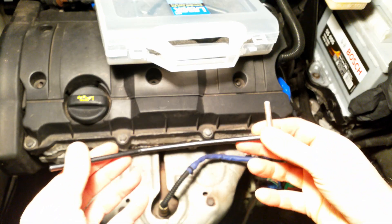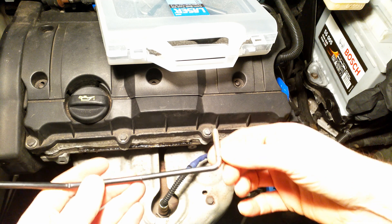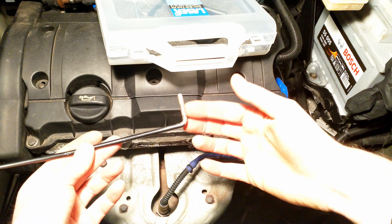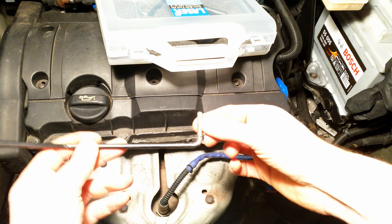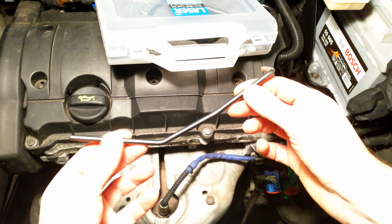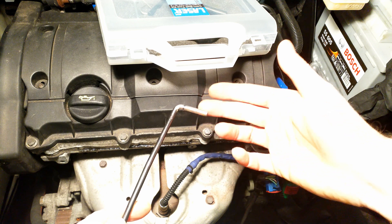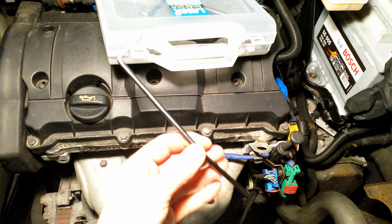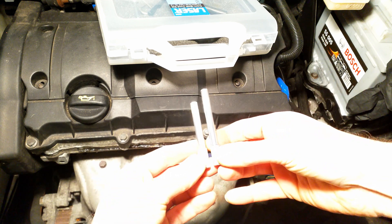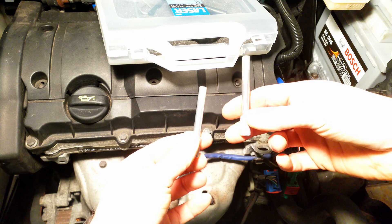The tool for pinning the flywheel crankshaft is six millimeters. The hole is six millimeters, but this doesn't fit due to rust and wear — the hole gets rough. So I've filed it a bit; currently it's 5.7 to 5.8 millimeters. You can see there's paint here and I just filed it slightly. So five and a half millimeters will work perfectly — you can shape a five or five-and-a-half millimeter pin. The camshaft pins are eight millimeters — both are eight millimeters — so you can use something from a drill bit.